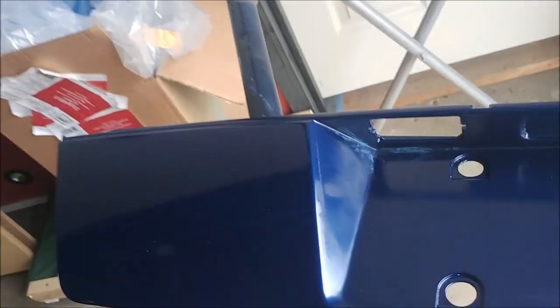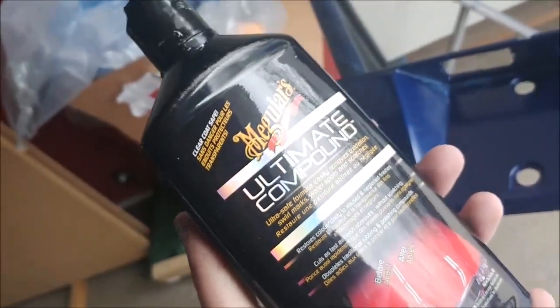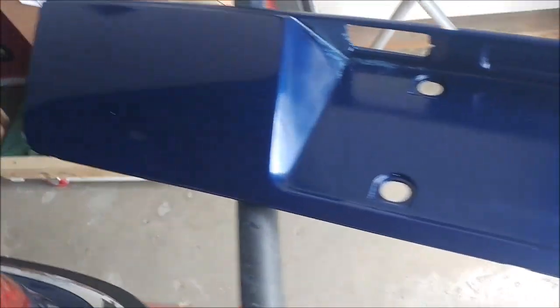The difference between painted, wet sanded, and buffed. Buffing is where you take a rubbing compound — this is my favorite, and a lot of people's favorites — where it's not like a wax. You don't apply it and it makes it shiny; you apply it and it sands the surface much finer than wet sanding does.